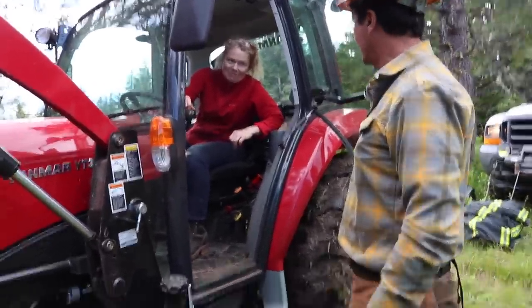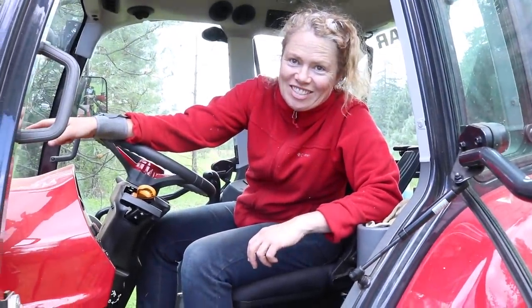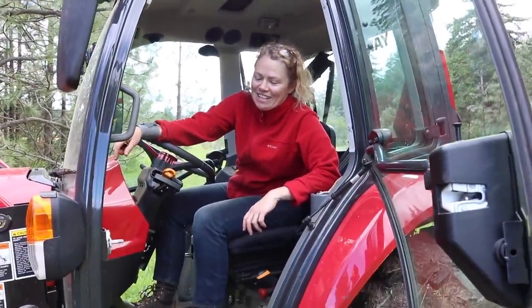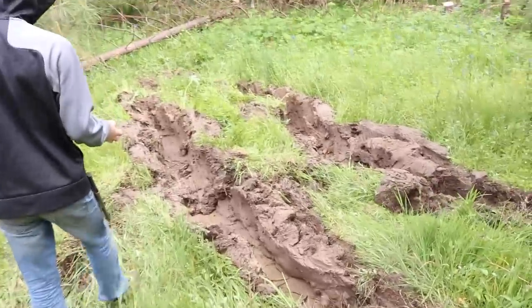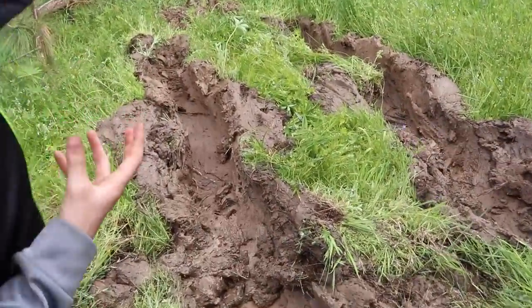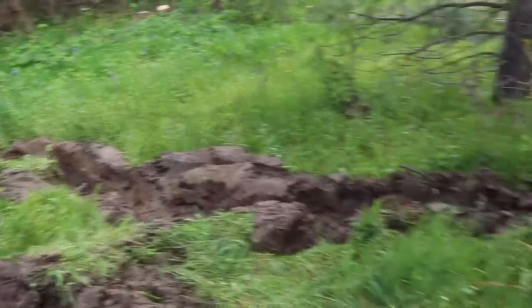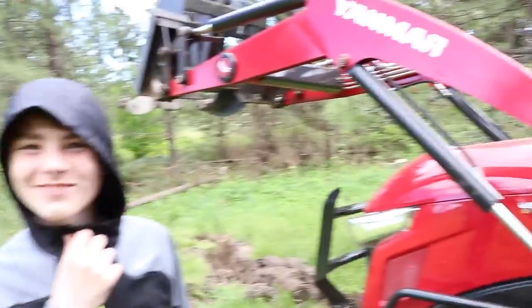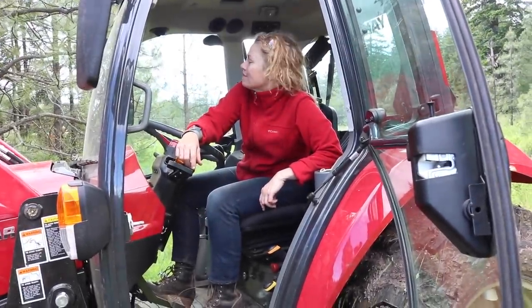It's okay. I'll take it out from here. Good job. It's a fine balance — you started out really good, then you put lots of gas in and started digging. You've got to watch your tires. If they start spinning, less power. You were literally digging your own grave. Just enough power to keep helping me out but not digging yourself a hole. These are really knobby tires — in seconds they'll dig themselves in. Once you're sitting on the belly pan, you're hosed. She mentioned she wanted the back window closed in case the winch line broke — that would probably help. So we'll go back to our old method — this approach isn't working.